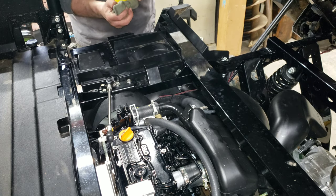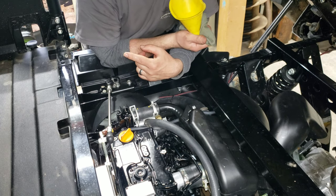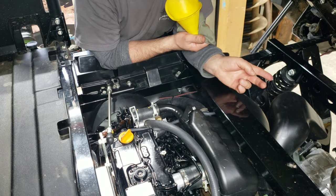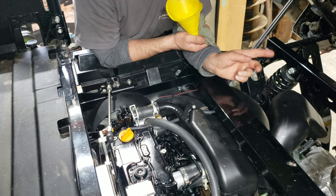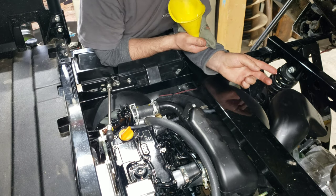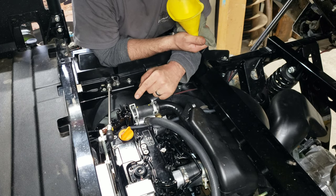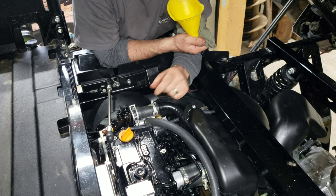Anyways, thank you for watching, and I hope I helped you out. So if you remember, you need that 8mm Allen wrench for the front diff. You need a 17mm socket, and you need a 14mm hex for the rear diff slash transmission. You need a 17mm socket, short extension, to do your drain on your oil pan of your engine.